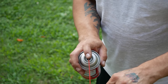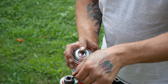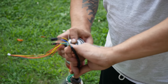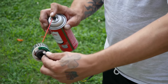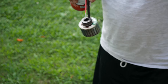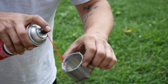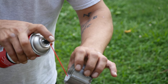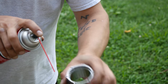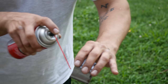Just make sure all the fluid washes out of the motor. This stuff evaporates quick and doesn't leave residue behind. I can see the dirt washing right off of it. I see all the black washing right off. Now, try not to touch the inside of this with your fingers after you clean it — just the grease from your fingers can be detrimental.